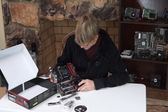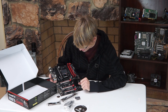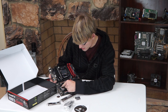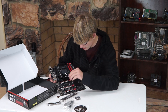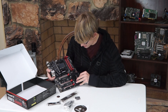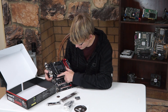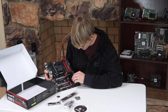As you can see, it actually looks a little Spartan without all those PCI Express slots you're really used to. And that's because of this little tiny M.2 connector, which is a 22 by 80 connector — so it goes all the way up to 80mm. There is a little screw included with the M.2 connector, which is really nice. It has six SATA 3 six-gigabit-per-second connectors. And it has three 16X slots — one of those, the last one, is an 8X electrical. And there are three PCI Express 1X slots.